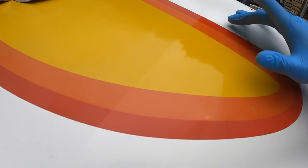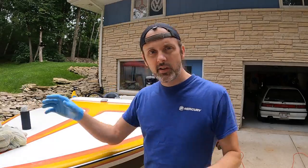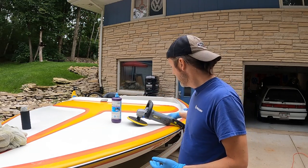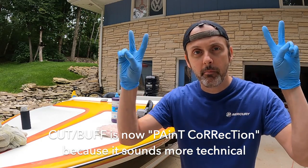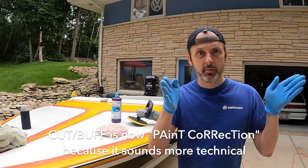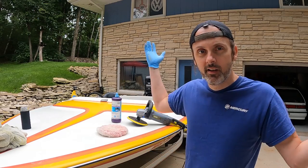The nanotechnology of the cyborg molecules really chemically bonded with the gel coat to create a barrier of bullshit that you're going to spend $60 on a tiny little bottle and pay some dude who had barely any training to do this for like two grand. The reason this irritates me is that this used to be just called a cut and buff. You used to use a mild abrasive and a buffer and that was like two or $300. And they would just polish your car out. Now they did the exact same thing, only they call it paint correction — they went from $300 to about $1,500 to $2,000. But it's really not hard to do. You just wet sand any flaws and then you buff it with a buffer.